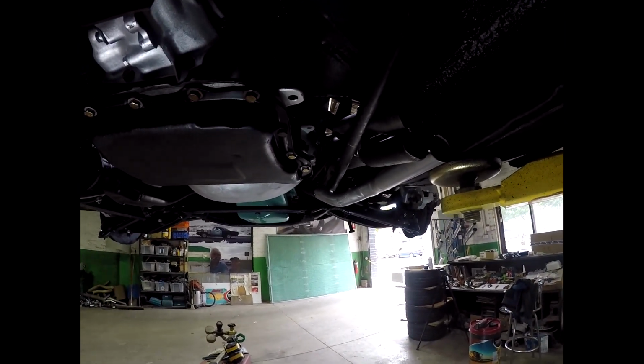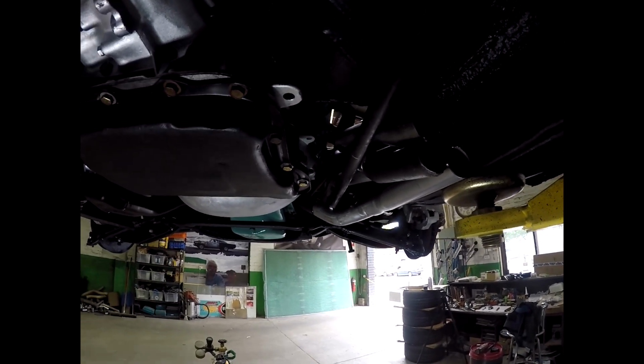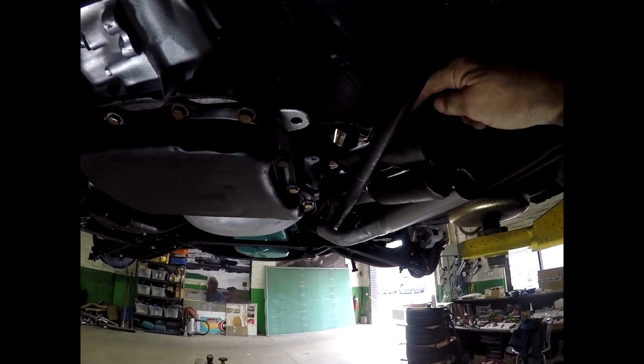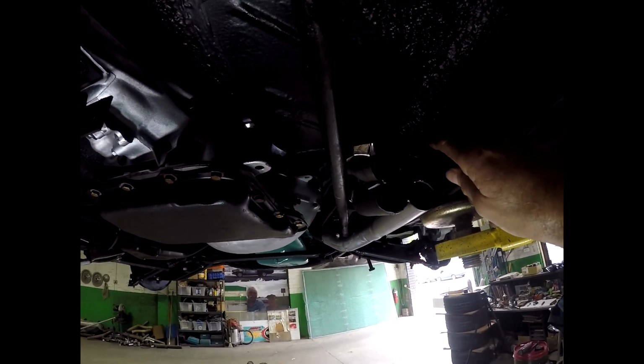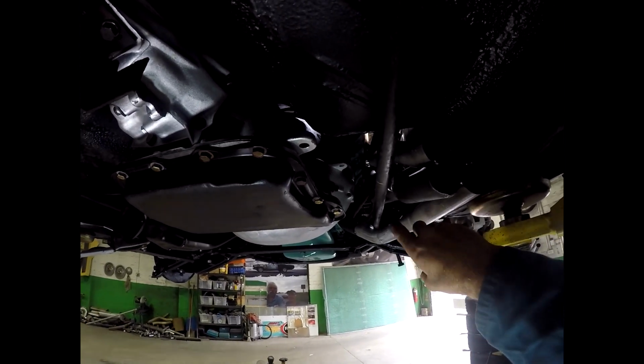So you've got to use your old brain box a little bit doing this sort of work, because I had to bring the back one, the two top ones in first before I brought this one in afterwards, otherwise I wouldn't be able to get past. So you just have to think about it when you're doing it a little bit. And then bringing this underneath meant I didn't have to worry about trying to crowd it in there. If I had built the extractors maybe from scratch, I probably could have got all four of them down inside the torsion bar, but the fact that I started with an existing extractor, I kind of made do, compromise, whatever you want to call it.